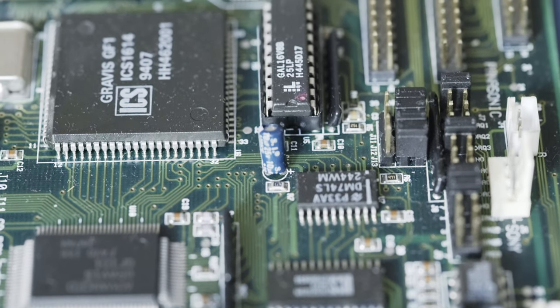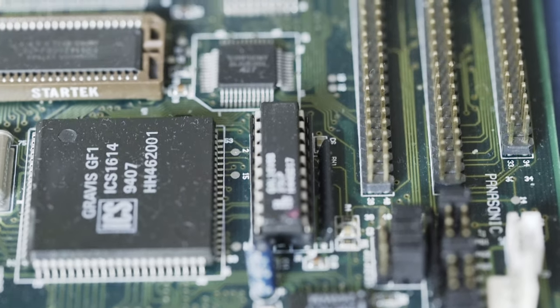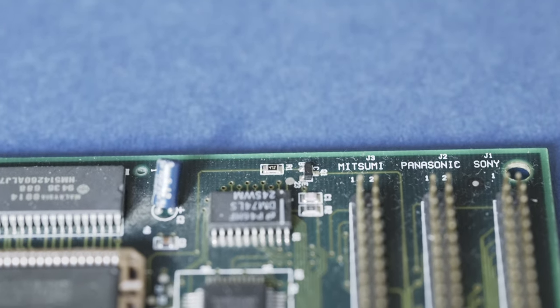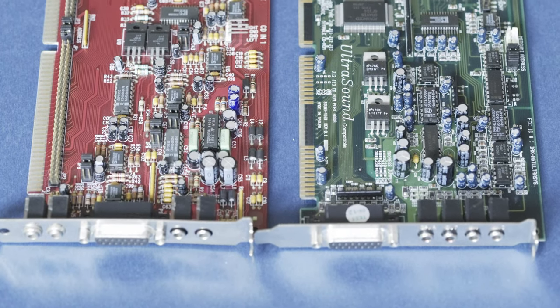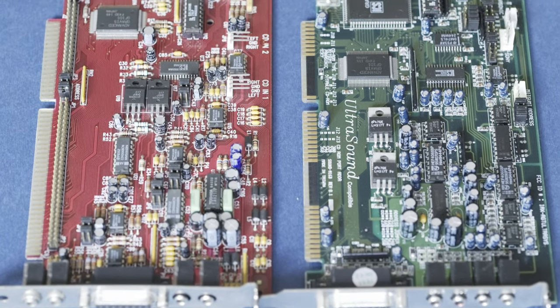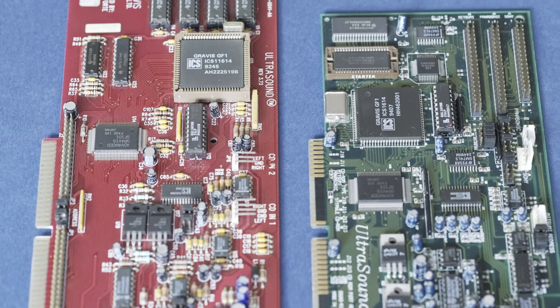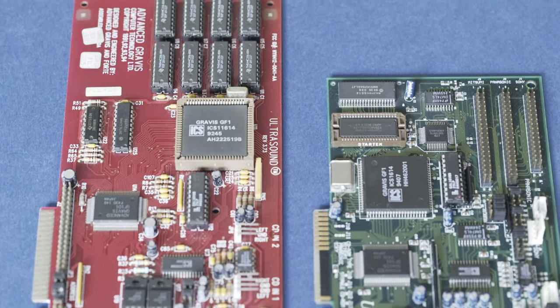SBOS can emulate Sound Blaster Pro and Adlib. MegaM is able to emulate Sound Blaster, Adlib, Roland MT-32, Sound Canvas, and General MIDI. Even though MegaM is able to somehow emulate FM synth, it is bloody horrible. SBOS does a much better job, but it's a far cry from perfect.